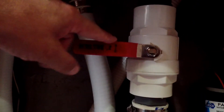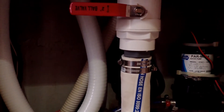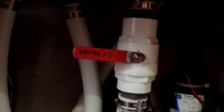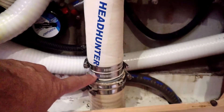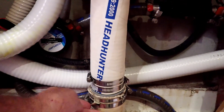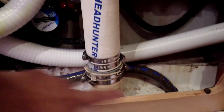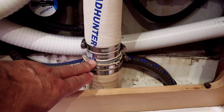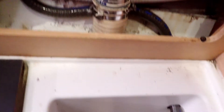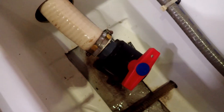Here's how it looks below — basically the piece shown earlier in the video. This prevents waste from going down into the pipe, so there's no permeation happening and creating smell. I can confirm there is no smell with this system so far. The valve up here along with the through-hull at the bottom of the bilge really seems to work. Here's the connector piece going from the two-inch hose to the 60-millimeter hose — just clamped, no leakage at all. This was the existing hose on the boat; I just cut it right there. Eventually during a refit I may make it two-inch all the way to a two-inch through-hull, but right now we're using the standard factory through-hull.